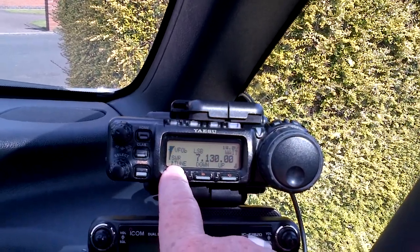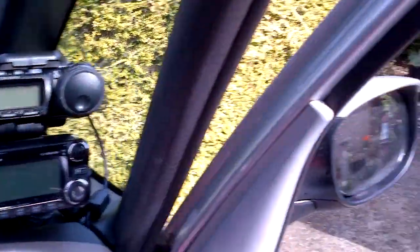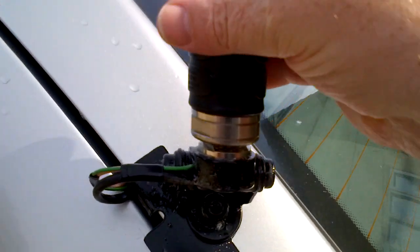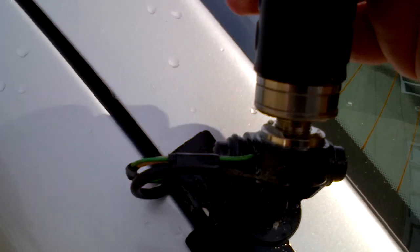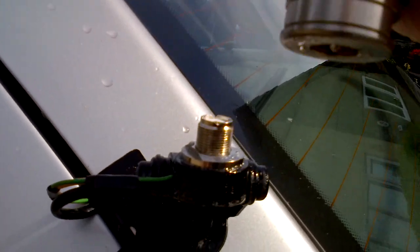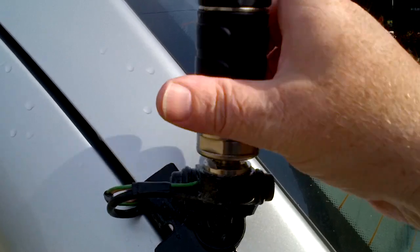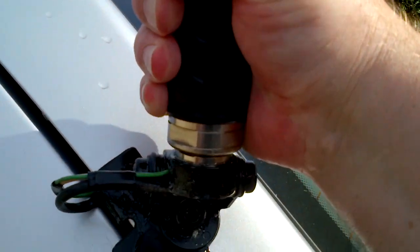Let me just stop this. Now, just put it back on ATAS, turn the radio off, pop back out to the back of the car and I'll undo the ATAS. I'm thinking about adding some earth somewhere on the bottom here. This is all the stuff that's there — that's lacquer, clear lacquer, just to give it a bit more waterproofing. So that's off now, the ATAS is off. Reconnect everything — and I know the ATAS will work now. Hopefully. That's the ATAS back on, nice and secure, everything's secure there.